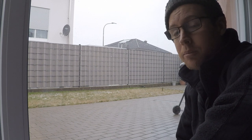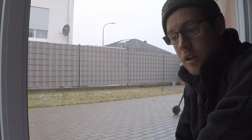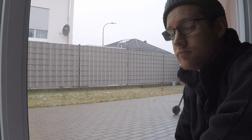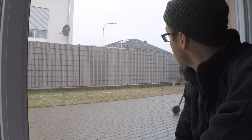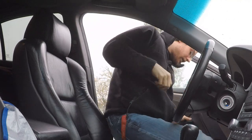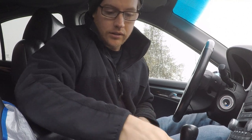It's not the best day to be working on things, especially with this super small shop, but today I want to cover an e-brake adjustment on my wife's Acura TL while it's starting to snow. We're going to be adjusting the e-brake today — it is just way way too far up. Usually about six to eight clicks, it should start catching; this one is not.